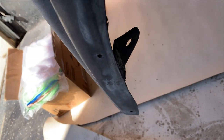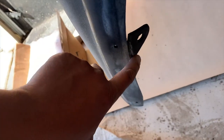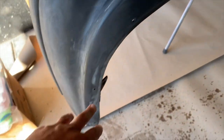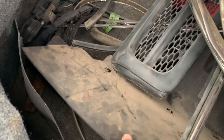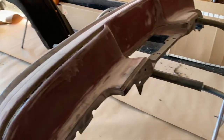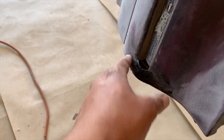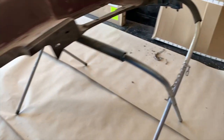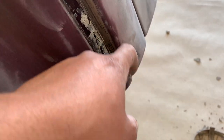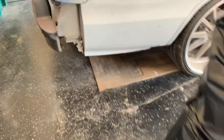Also, one of these tabs on the inside was broken - it was snapped and just flopping around. All I did was plastic weld it together, and now I can attach the lower part of the bumper to it. No harm, no foul - at first it was flopping, but now we'll be good. Also fixed this area here with plastic weld - that's the part where someone backed my car into a wall and it had broken off. I just gotta body fill over that, shape it, make it look nice just like the original side, put that little indention in, and we'll be good to go.